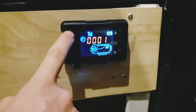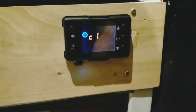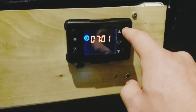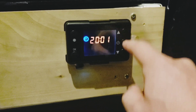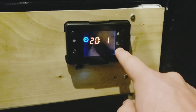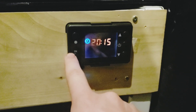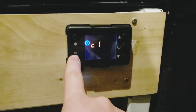If you press and hold settings, that brings you into settings. The first setting is going to be the clock. Hit power — that brings you into the setting. Here it is 8:12, so it's in military time, so it's 20. Power again to get to the next one — 15. Then you hit the setting button; the okay button is how you scroll through the settings.